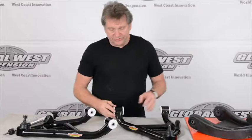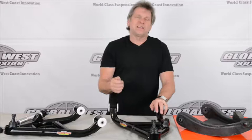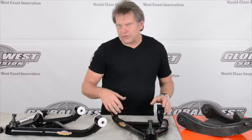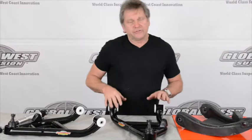This particular control arm also features a special bushing we use for drag racing only. It allows this control arm — once you bolt this on the frame and torque it to 70 foot pounds — this arm will literally fall; there's no resistance. In the old days, you'd take the stock rubber bushings and loosen the bolts, and that's how you got the arm to drop. The problem is you get a lot of deflection on the control arm, something you don't really want doing 100 plus down the straight. This product controls that movement. Once you bolt this down, this arm is a straight up and straight down application — it's not deflecting — so it actually makes the front end more stable.